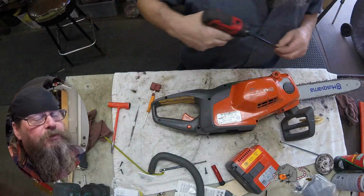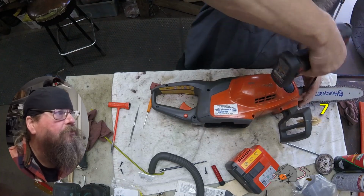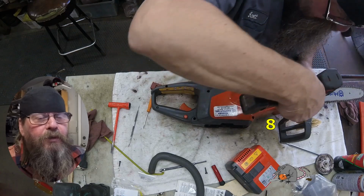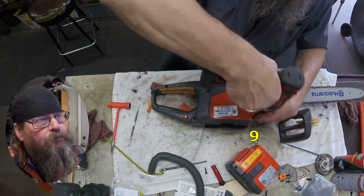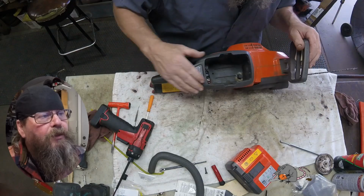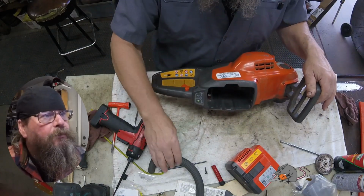You know, these screws, they're just going into plastic, so don't get carried away. I have the clutch on this tool set probably on number 3. And that's where, on this Snap-on driver, I usually keep it when I'm driving screws into plastic. And the nice thing about this driver is once you stop turning it, it stays locked. So then you can manually crank the tool a little tighter or looser, depending on what you're doing.